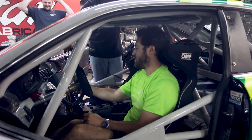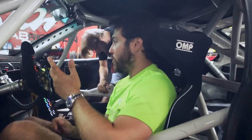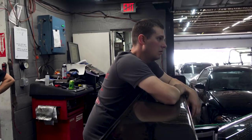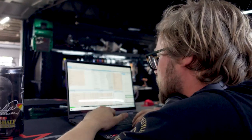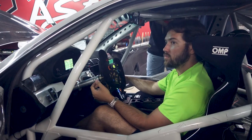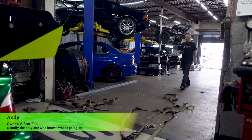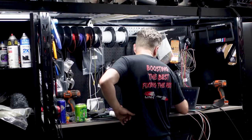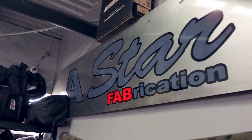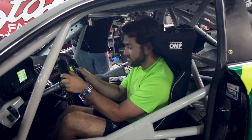Attempted to start the car — not going well. Should have been plug and play. Mike's trying to start the car, putting the four-ways on. Turns out there was an injector plug issue with something set to always-on. We slapped the injector plug back in and tried again — and it started!